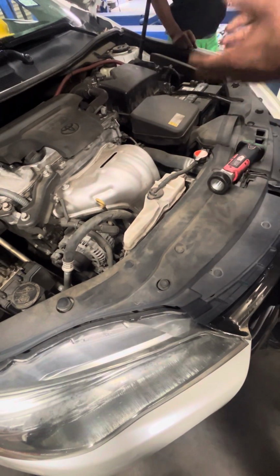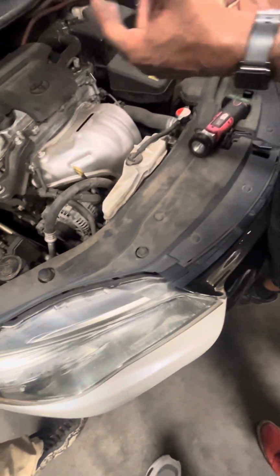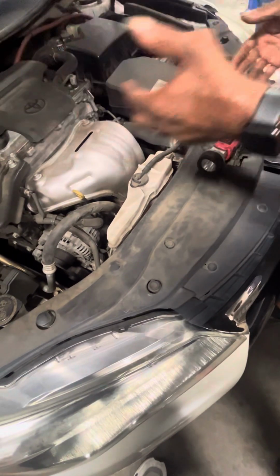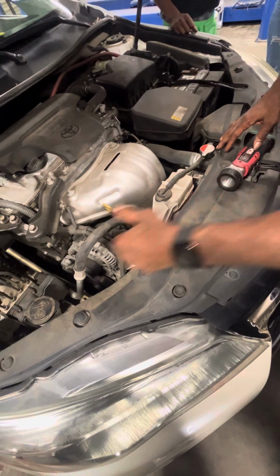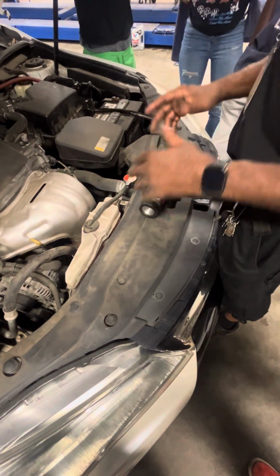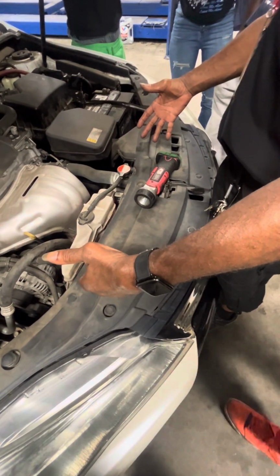But you can check all of that by just getting a temperature reading, if the engine is hot. The whole radiator should be no different than 20 degrees from the upper radiator hose, where the tank is on the top, to the lower, where the tank is on the bottom. So the coolant runs vertical, up and down. In the other type of radiator, the tanks are on the side, so the coolant runs horizontal.